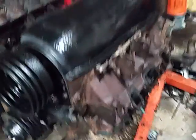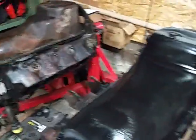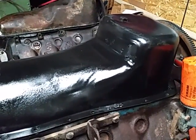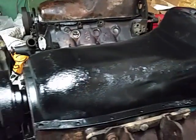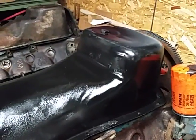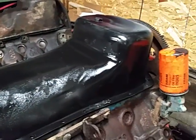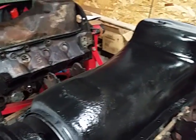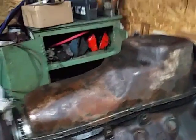I don't have things exactly the same here — this one has the head still on it and has the engine mounts; that one's been stripped a little more. I'll start with a quick teaser: the difference between the oil pans. You can see that the regular 350, out of about an '85 Cutlass, has a plain sump — really no depressions for the chassis. This is about a four-and-a-half quart oil pan, with a half quart in the filter, and as you'll see in a moment, there's no baffling in it, no tricks — it does the job, it holds the oil.